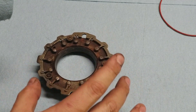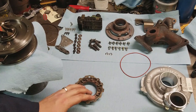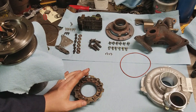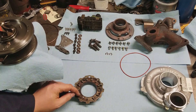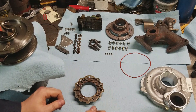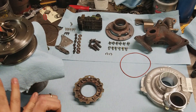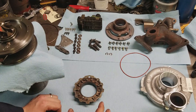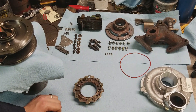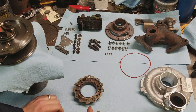Next thing, we're going to put this inside the turbo core. Once I get this installed, I'll actuate it and demonstrate how it works. When reassembling this, you kind of need to have three hands because these little rollers in here — everything needs to be put down at exactly the same time. When reassembling, do not use any lubrication of any kind. This whole thing on the turbine side, the exhaust side, is designed to run dry. Because of the extreme temperatures and the carbon coming in, you don't want anything wet in here.